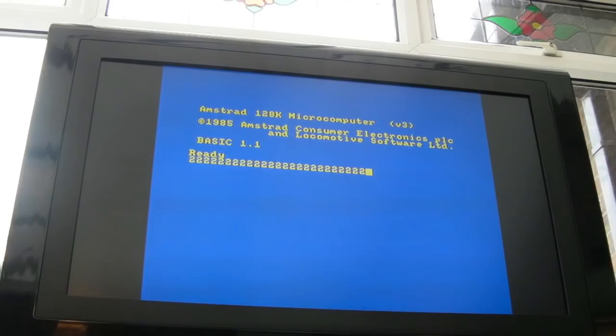The reason the H key worked super quick, I'll show you that. As soon as I dried it, it worked straight away because it's a really short, tiny little bit that we've painted. This one is quite a lot longer, like 7 or 8 times longer. But anyway, nevertheless, that's fixed it. So I'm going to clean up the dust and fluff out of the keyboard shell, reassemble it, and just test all the keys work.